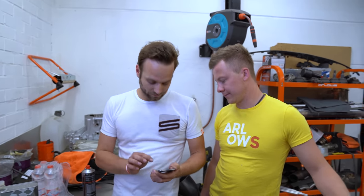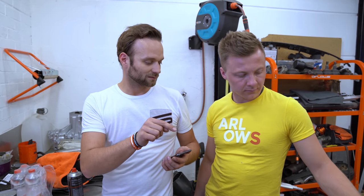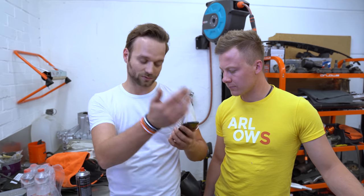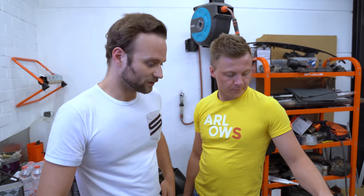So already slightly higher. But still everything under 8:1. I'd now say we're definitely where we want to be - or rather, we can be pretty sure it's somewhere between 7.8 and 8.0. Probably exactly 7.9. We can't change it now anyway, and we'll leave it as is, because we can't make the head gasket any thinner. So we'll now finish building the engine, and next up will be the gearbox. We're not going into more detail on the cylinder head here, because we made a small video series at NG. We wanted to show you step by step everything about the head, so look forward to a few more episodes on the cylinder head. We've learned something new again - see you next time. Ciao.